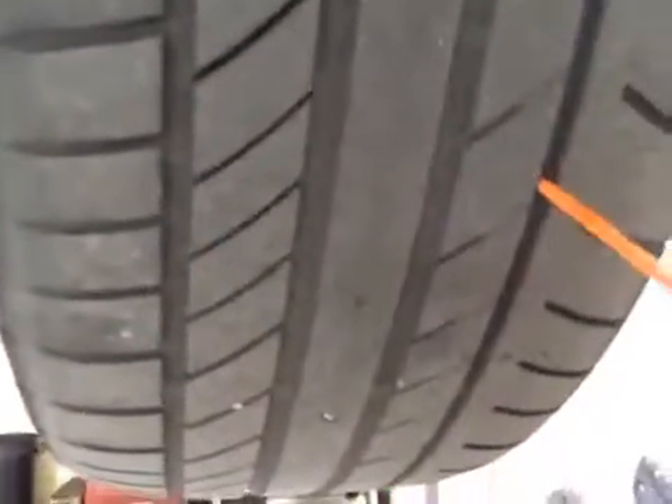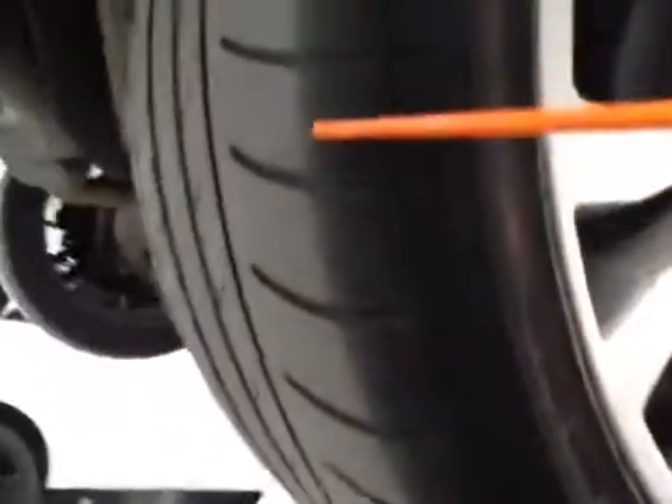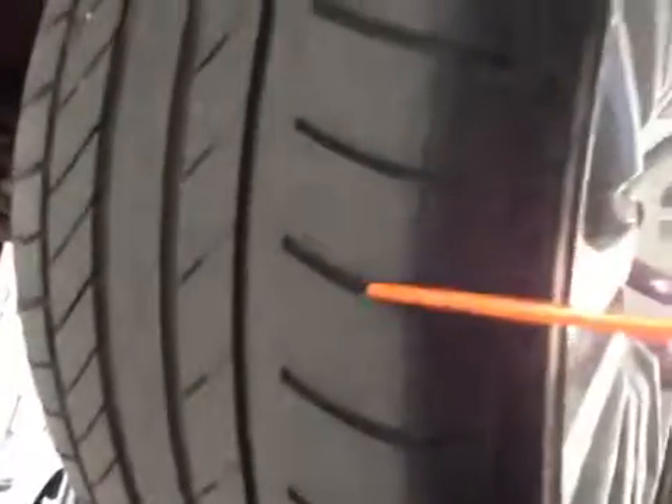This is the driver's rear tire. The tire is just at 3 millimetres of legal tread depth — this tire is in amber. There's slight wear on the inner edge of the tire, so I'd recommend a wheel alignment to be carried out. And there's a slight cracking on the edge of the tire around the outer edge.